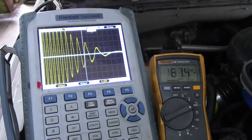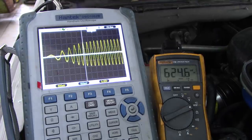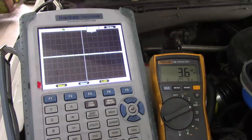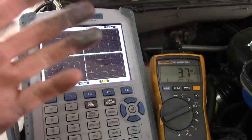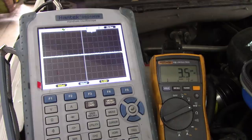What a difference! We're getting 300 plus millivolts out of the sensor — a huge improvement. That is also why I bought two wheel speed sensors, because the other side was still over that 100 millivolt threshold, but not by very much — certainly not as strong as the new sensor we installed. So we're going to tear apart the other side at a minimum, clean the mounting surface. But chances are we'll break that one too, so go ahead and replace it.